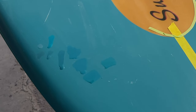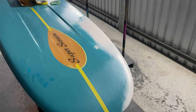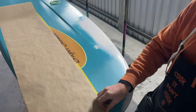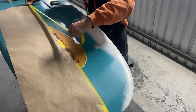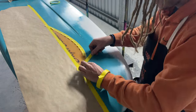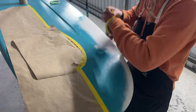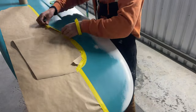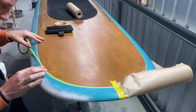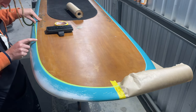Moving inside you can see how many attempts it took to get a colour that I was satisfied with. Now that we're satisfied with it we can mask it up and get it ready to paint. It really is a case of adding very small quantities of paint to your mixture and slowly building up to where you want to be. It's really easy to add two or three drops too much of something and ruin the colour and not be able to bring it back. So definitely pace yourself with colour matching and paint mixing — slower is better for sure.